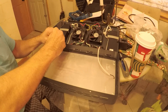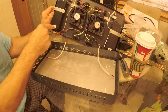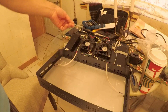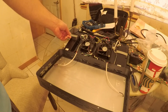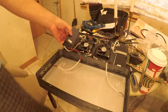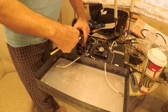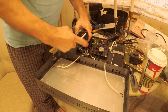I'm going to connect that back up. Next we're just going to go ahead and back these two screws out. This is just the hold-down bracket that holds the driver box — the LED driver — on. That's just a Phillips bolt that you're going to unscrew. It's just the hold-down bracket to hold the driver box down.